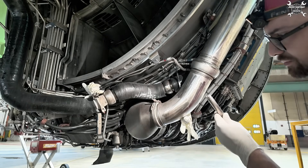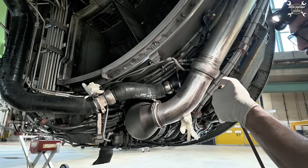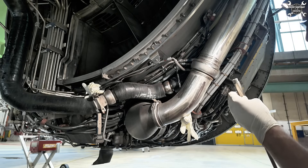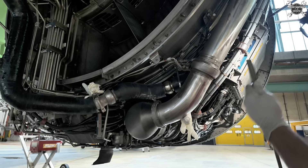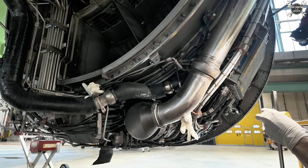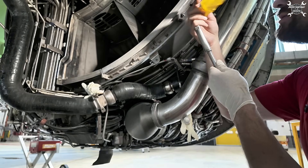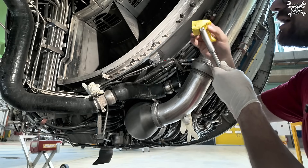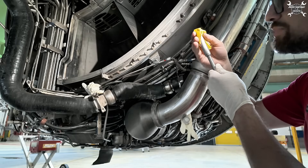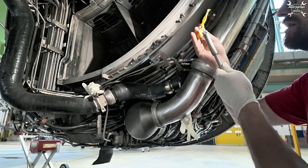You need to be sure that the sensor is completely clean — nothing is allowed to remain on it. For that you should use a piece of tape to remove everything that can remain on the magnetic tip, because contamination can lead to misreading.